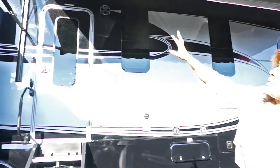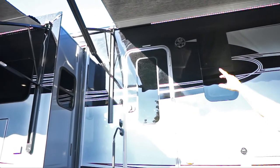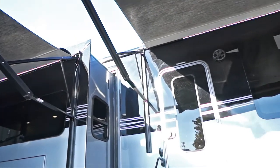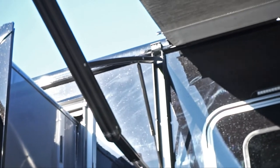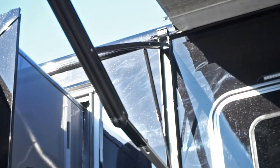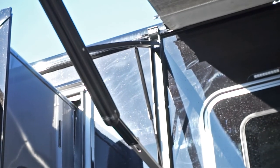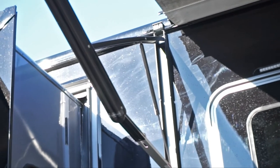The paint actually gets brought over the top of the roof a little bit. You might think that's the TPO roofing material, but it's not — we actually put a metal guard on top because that holds the paint better than TPO. No matter how well you prep TPO, it's still TPO. That's why we use metal when doing the full body paint to wrap the roof line.